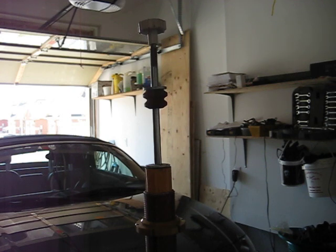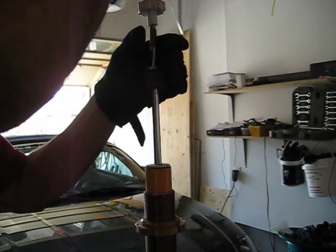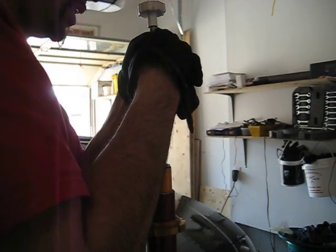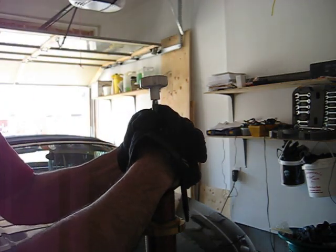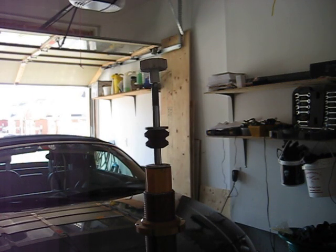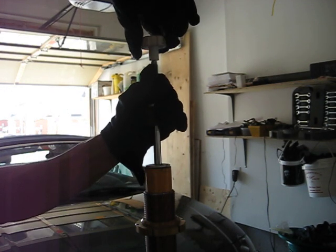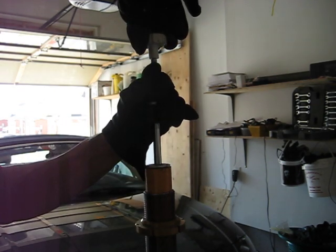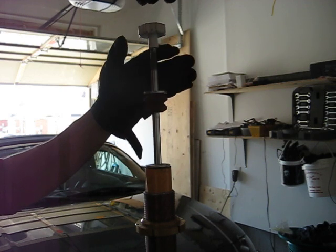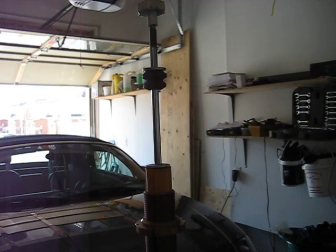As you can see, in the full firm position the cylinder — the shaft — basically doesn't come out. This is at an eighth off full firm. If I was to lock it right now at full firm, it almost stops the cylinder from moving out. And an eighth turn out starts to move all the way to the top.